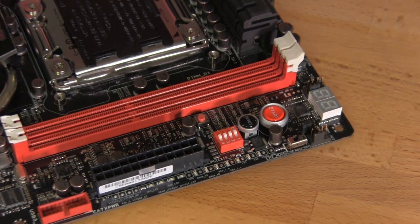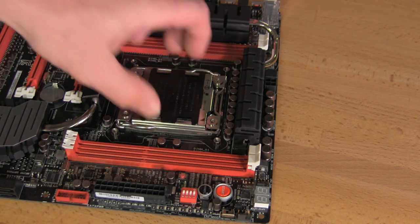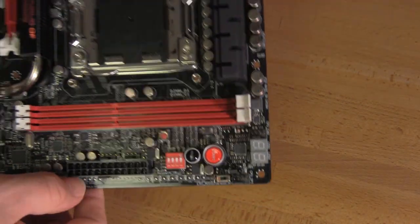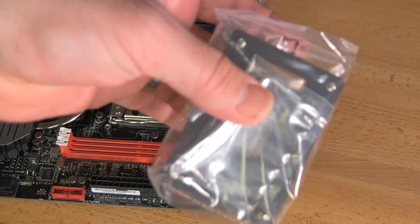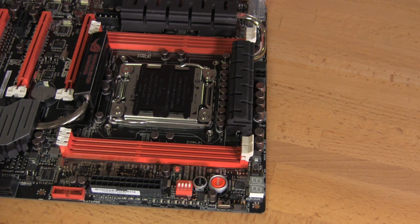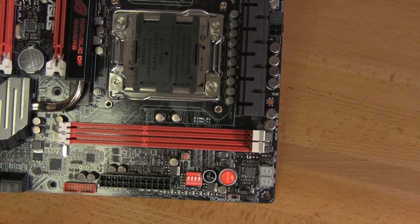Taking a look at the CPU socket — your typical X79 2011 socket. What ASUS has done is allow you to remove this entire socket bracket and replace it with their X socket backplate. All you do is unscrew the mounting points using the included Torx bit, pull off the entire socket cover, put the new backplate on, and it will cover just the CPU socket itself. This gives you more flexibility for overclocking — putting different-sized pots, whatever you want — without being limited by the CPU bracket that Intel mandated with X79 and 2011 motherboards.